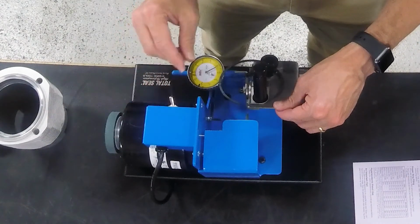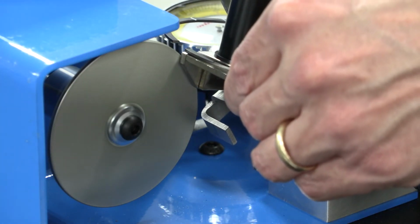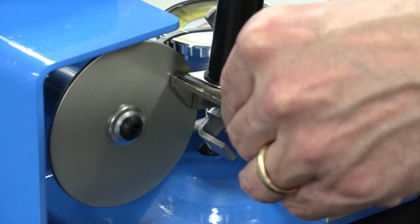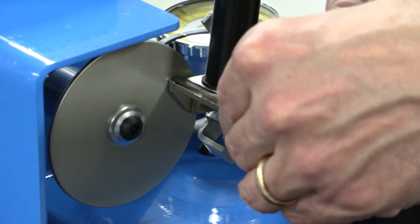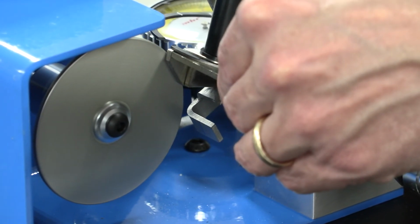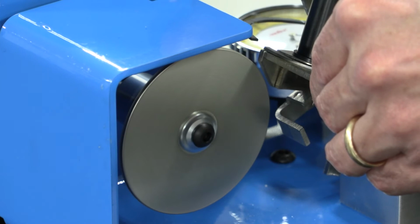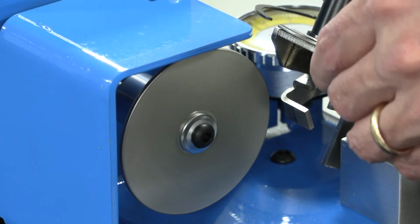I'm going to start the grinding wheel, and I'm going to move very slowly, moving the ring into the grinding wheel where it cuts that much off. Move it back and back. Move very slowly so you don't grab the ring. And now, as you see, no sound, no cutting. It's removed right at 2/1000 of ring material. Let it spin down.